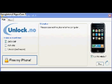It will tell you to turn off your iPhone. Once you've turned it off, you're going to want to hold the power button and the home button at the same time until you see the Apple logo. Once you see the Apple logo, you're going to release the power button and keep holding the home button. You should have to hold it for about 5 seconds, and then the connect to iTunes logo will appear.